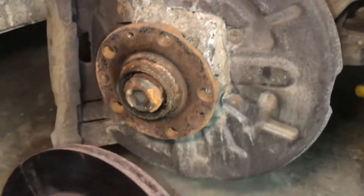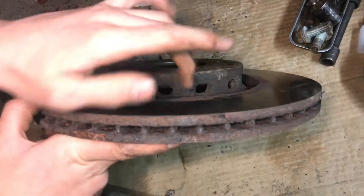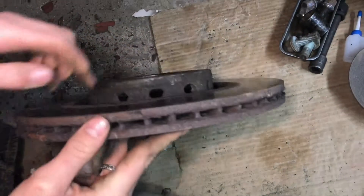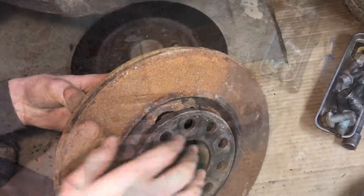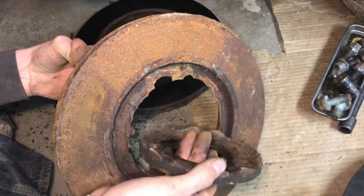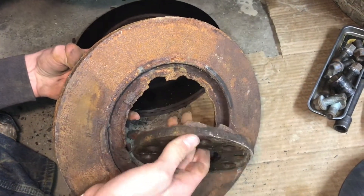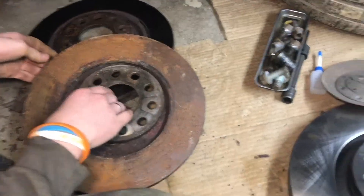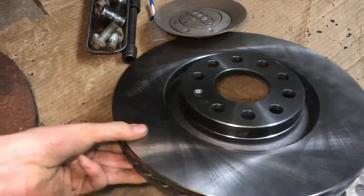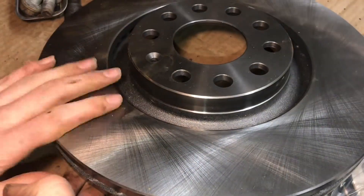Wiggle off the rotor and we got it off. If you can, try to avoid getting rotors with holes in them — I'll show you why on the other side. These are kind of a failing point. Here on the other side, you can see this just totally broke into two pieces. I've never seen that happen on a rotor, so I would really recommend not getting rotors with holes in them. The ones we got don't have the holes, and that's what we want — it's going to be a lot stronger.